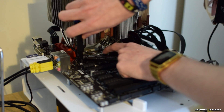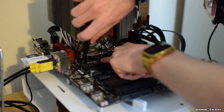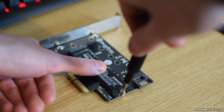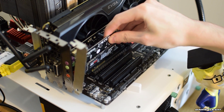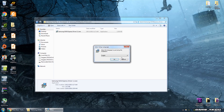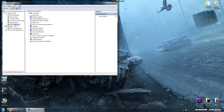The expansion card I picked up supports speeds of up to 32 gigabits per second, so we should be all good there. To install this SSD into an M.2 port, you simply need to remove the screw from the M.2 port on your motherboard, then slide the SSD in at an angle of 45 degrees. Once you've done this, screw the SSD into place. When installing the SSD onto a PCI Express card, follow the same instructions, but be sure to plug it into a PCIe x4 or higher port on your motherboard. Once you've installed the drive, boot up your PC and install the PCI Express driver that Samsung provides on their website, then reboot.